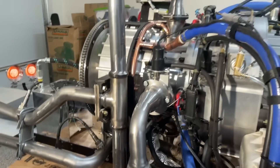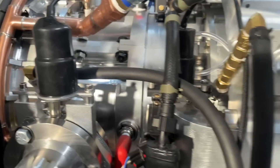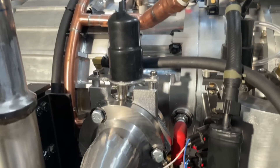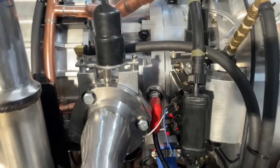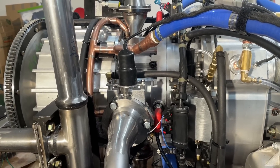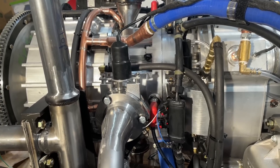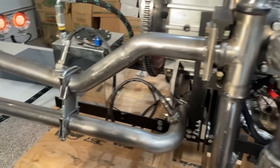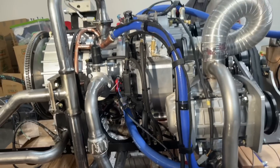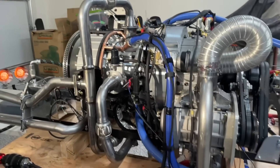It's got two cylinders that'll be deactivated, which is what this valve's all about on the exhaust side. It deactivates the intake through that valve, and then this valve closes off the exhaust. So that cylinder and the one exactly opposite on the other side is deactivated — has no fuel going through it, only has spark, but it's never making any combustion, never moving any air. It's closed off on the intake and the exhaust side with the deactivation valves. The other cylinders still have combustion going on. That's what the two lambdas are about — one for each half of the motor. The ECU thinks it's one bank and the other, and that's how it's able to make it function correctly.